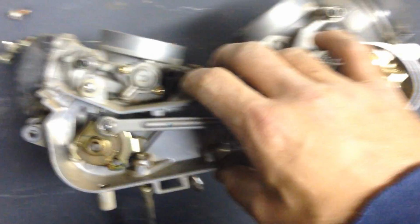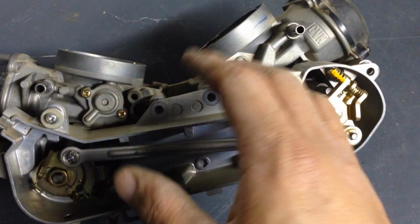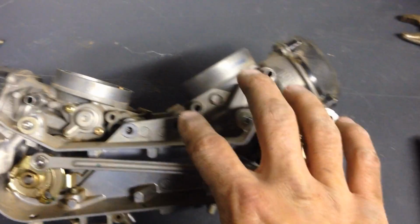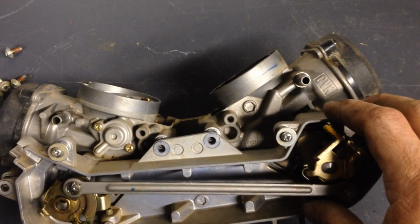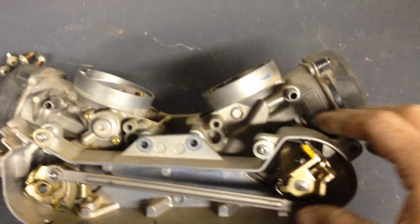But anyhow, that was this one, and I started slowly, and it started to strip instantly. These other ones, I just got right after it with the drill. I made sure and had it in there real good, and just pulled the trigger completely, and that popping action that the impact wrench made busted it loose. And you can see they had a little bit of Loctite on these, and they're pretty soft too, but I think that's why people are having so much trouble. I read a lot of people online say be careful with those.